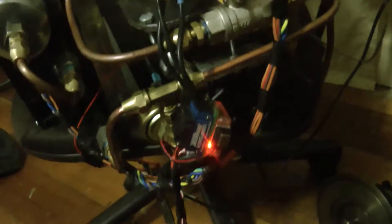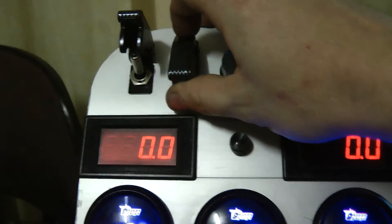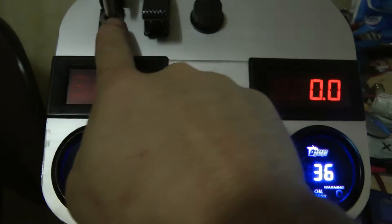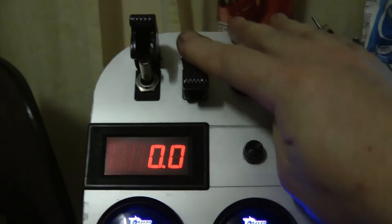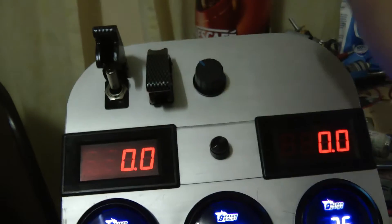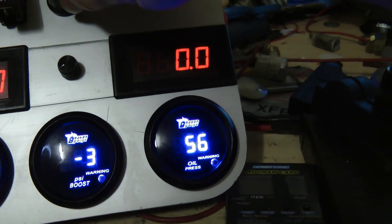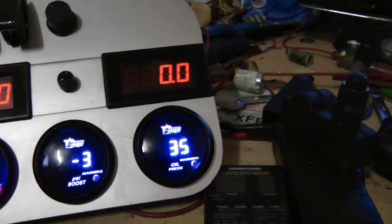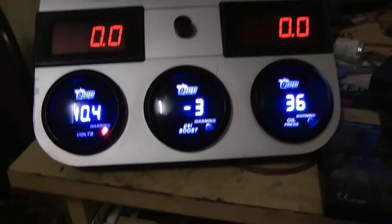I've got this to one umbilical cord — that hooks up to everything. I've even got the fans hooked up this time, so when you switch it on and off, it turns the fans on as well. The starter is on the on position. The whole unit is on so nobody bumps it and switches off the oil and burns out your engine. In run position you can turn the oil pressure up and down, and there's absolutely no fluctuation because it samples it — every third of a second or so.